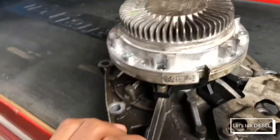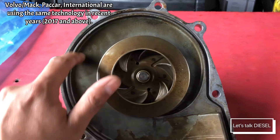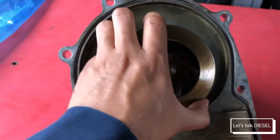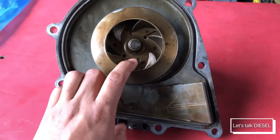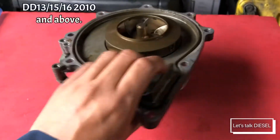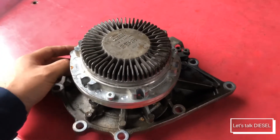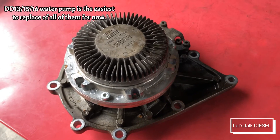The newer water pumps come like that now. Newer water pumps are using the same system as Detroit — they have two sensors or one single sensor to monitor how the water pump is working. If those sensors go bad, they're gonna turn on the check engine light, and if the sensor is gone you'll have to replace the whole water pump. The back of this pump is the same as the older Detroit engines. The good thing about these water pumps is they come with the gasket pre-installed, so you just take it out of the box, install the pulley, install the water pump — really simple.